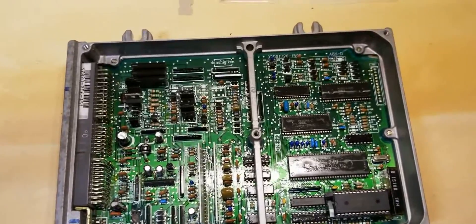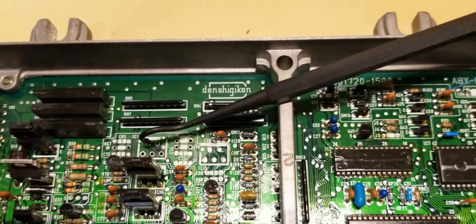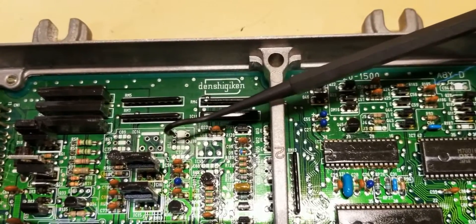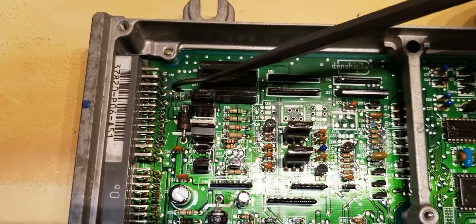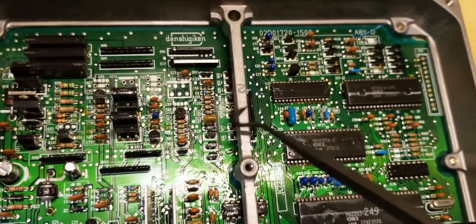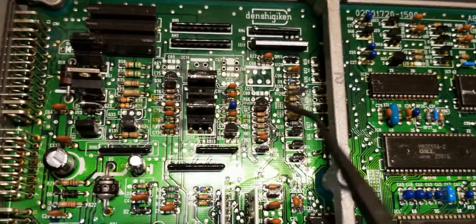We've got the areas desoldered. We have the IC4 with five pins desoldered, R67 resistor 67, C60, and J10 — all in the same upper left corner area. You're also going to desolder D11, diode 11, in the upper left corner. In the middle of the board, you'll find Q26 underneath the center ECU support. You can get to it without dropping the case if you're skilled; if not, take the ECU out of the case.